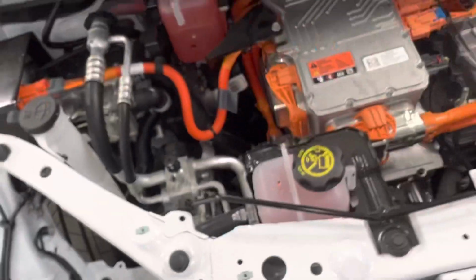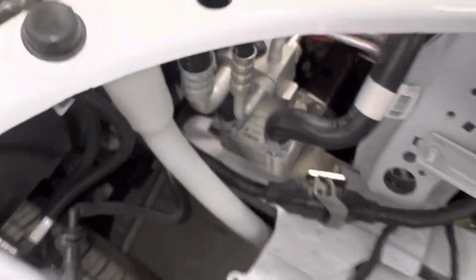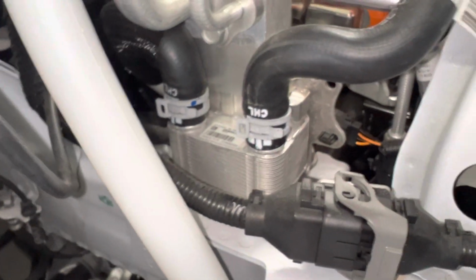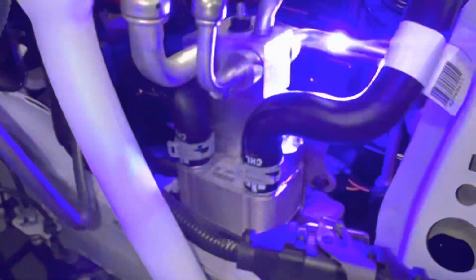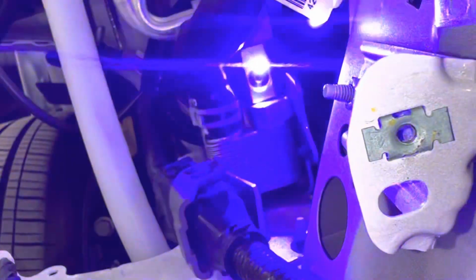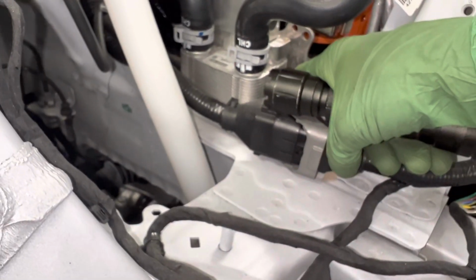Now on this one we have a second circuit on there. Not only are we cooling the passenger, but here's a plate heat exchanger. That little guy right there, that's a plate heat exchanger. And if you look above it, right there is an expansion valve, and then that's just the block right there. There's your service port and your lines in and out. And if you're used to seeing that, there's your plug on the bottom of your H-style expansion valve. So there's refrigerant actually flowing through this.